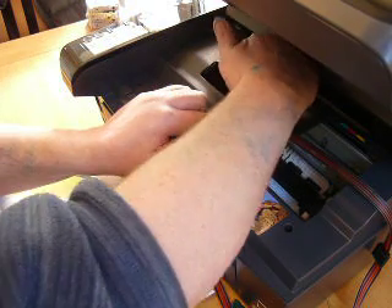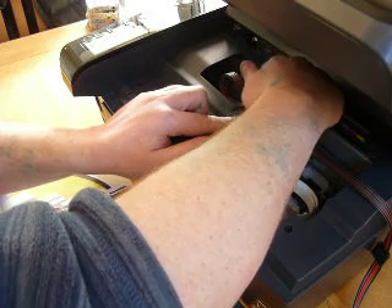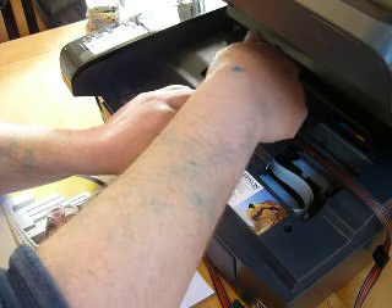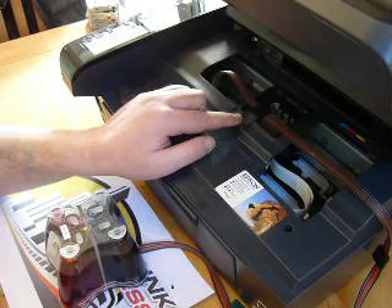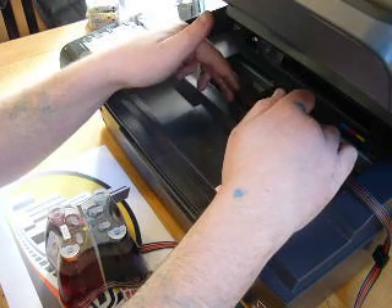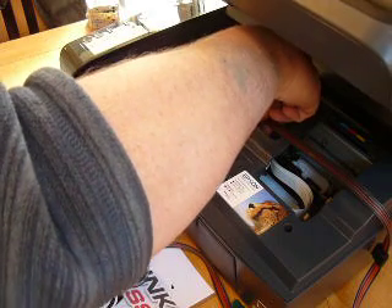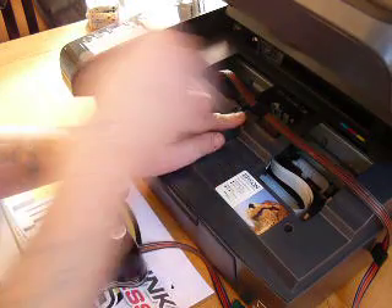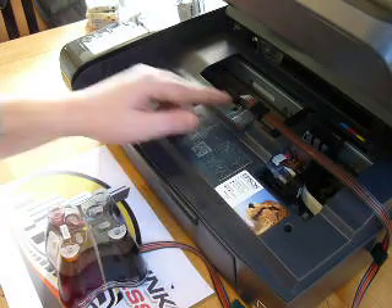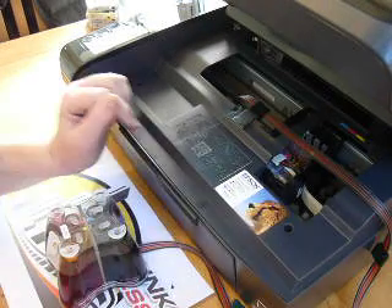The printer carriage does normally go a little bit further when it's printing, then manually push it all the way back. If you're getting the clamp catching on top of this when the printer starts to print, the carriage does normally drop down a little bit. But if you're concerned about it catching, all you have to do is hold it and bend the clamp up a tiny little bit — that will give it clearance. When the printer starts to print, this whole carriage drops down and improves the clearance anyway.